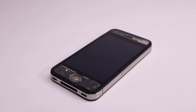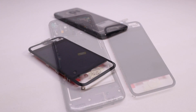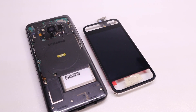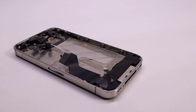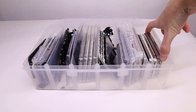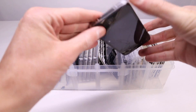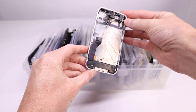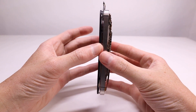I had purchased this custom transparent display assembly many months ago but haven't got around to installing it. The display is very hard to find online and this particular one is from eBay US — it's meant to fit a US-only CDMA iPhone 4, so I will have to make it fit the iPhone 4s. I'm going to use two housings: one to test the fit and one to actually install the screen.